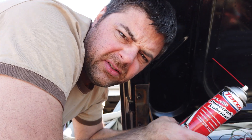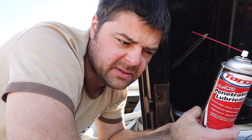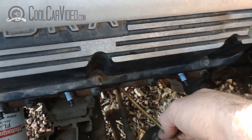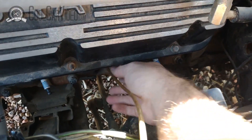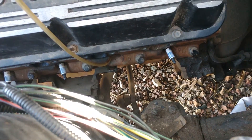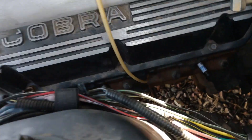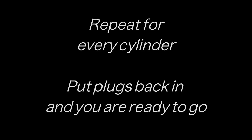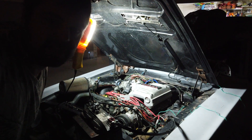For the final pre-lubrication step, I'm going to spray some PL50 directly inside the cylinders. Here's how it's done: feed the tube into the spark plug hole, then hook up to the PL50 can, squeeze tight, and blow it in. About three seconds per cylinder should be good.